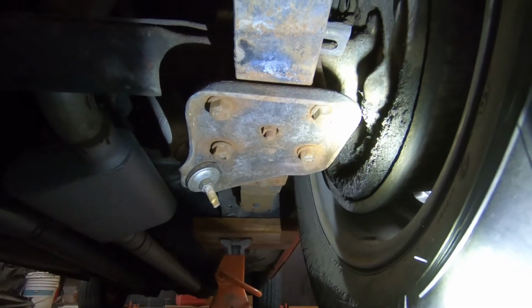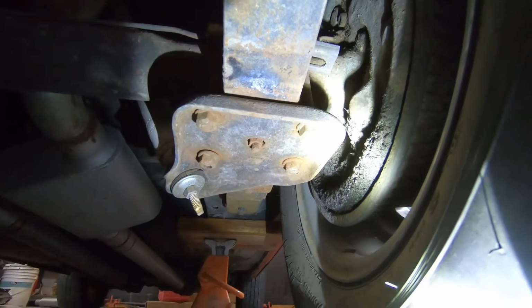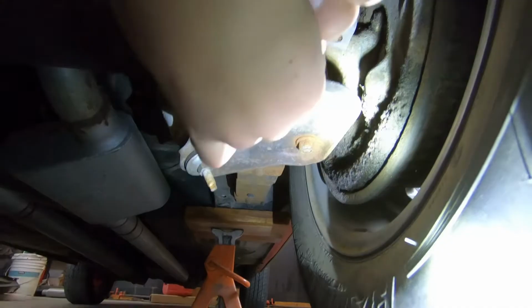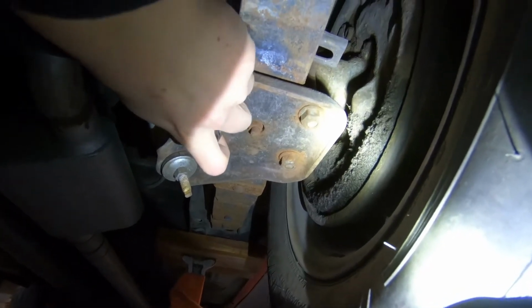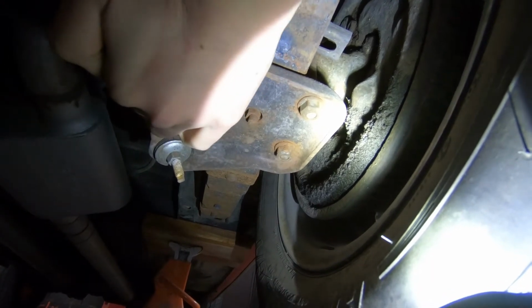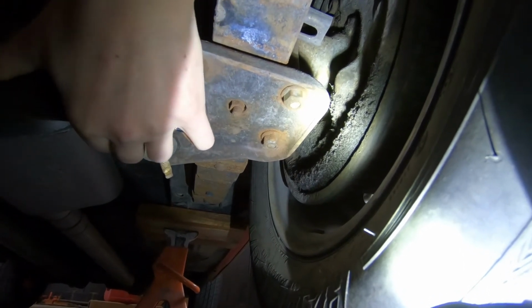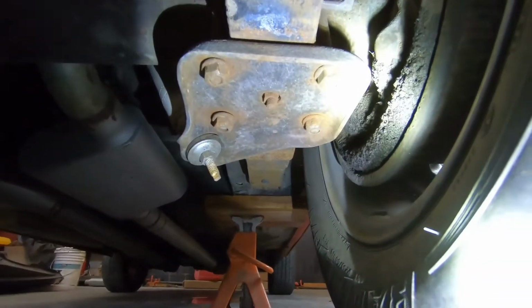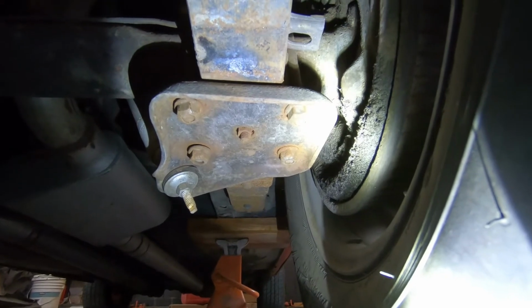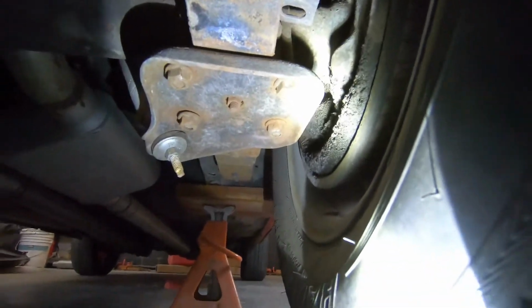Okay, now we're going to undo the four nuts that are on the end of the U-bolts that go over the axle. Kailey has her 11/16 socket, and now we're gonna undo them. How to make yourself mighty? Cheat. I am the mighty Kailey, the almighty, and you will bow before me. Is that so? Yep. I've always found it hard to get leverage when I'm on a rolling platform. Do not take the middle nut off, because it is a bolt whose job is to hold that leaf spring together. It has nothing to do with mounting the leaf spring to the car.